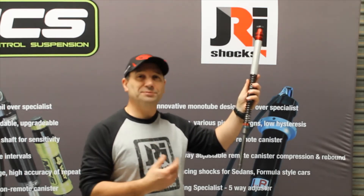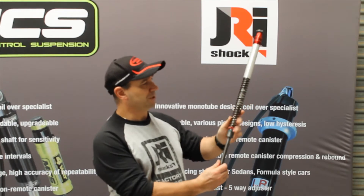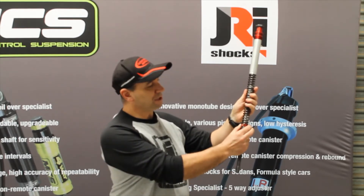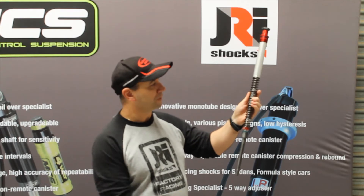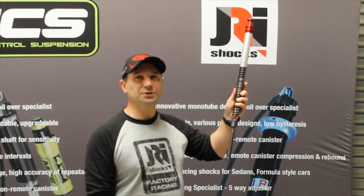They aren't specific to particular Touring models, but you can see with this particular design we've got that specified spring that comes with the actual cartridge. There is a pre-load adjustment here for the actual spring, and the inside components inside the spring have a Teflon coating.